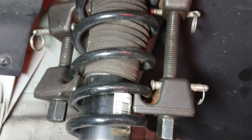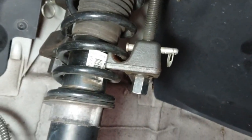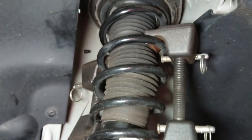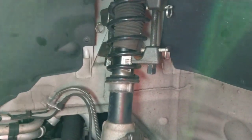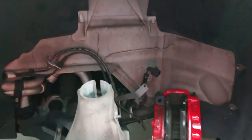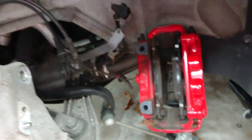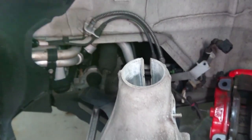I made some stubby compressors — just cut these down with a grinder, took about two minutes. I'll start ratcheting these down and see if I can get some distance. If not, I'll need to pop the joint at the bottom but I'll try to avoid doing that. After all that pushing and shoving — and I had to take the caliper off which I forgot — this is out. I did not need to take the lower connection off; I was able to pull it straight out.